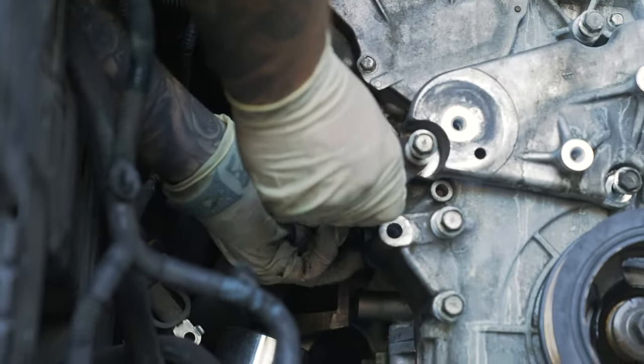All the goodies are on. I'm going to throw the timing chain arm on, put the chain on, put the top guide on, and last but not least put the tensioner on, check timing, make sure everything's good, and then start cleaning the cover — cleaning meaning with a razor blade, getting all the old silicone off this cover and the back cover, and then be ready to assemble. So I'm going to tighten this arm up right here.